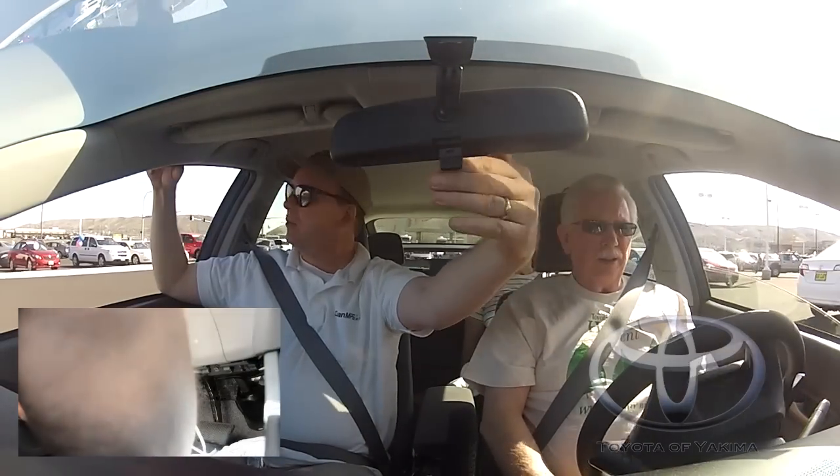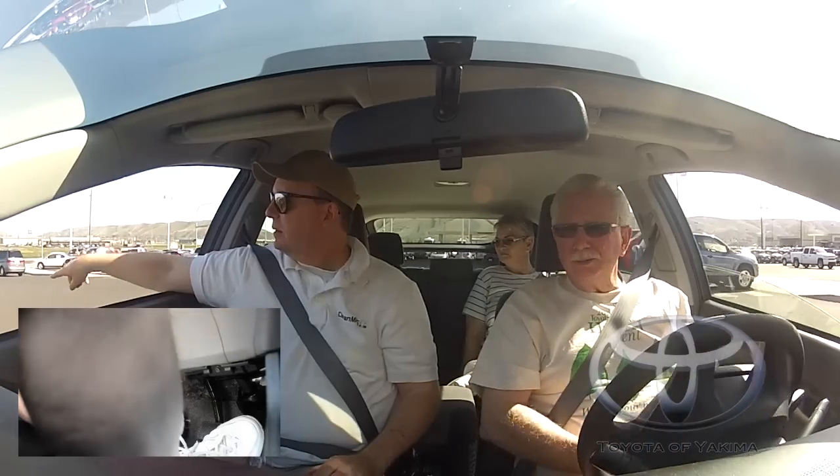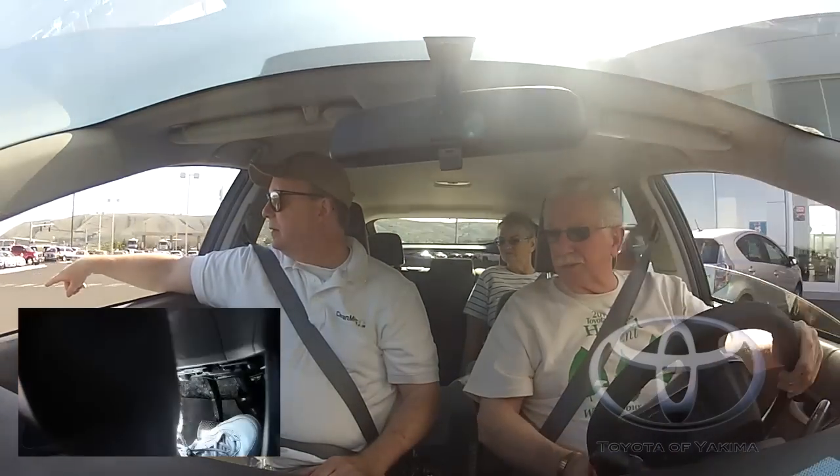Okay, now I want you to spin it around so you're facing downhill. Face downhill here. That's what we love about this car. You can spin on a dime. Yeah. Now put your foot on the brake, left foot. The right foot, punch into the accelerator and get the engine running. A little more, right there. You're charging the battery right now, okay? And all I want to do is bring you up to about 4 bars.